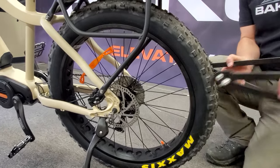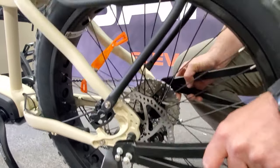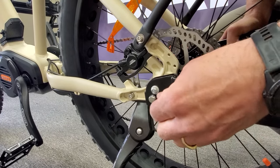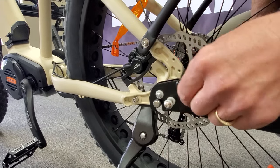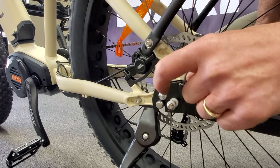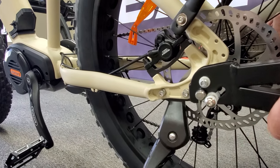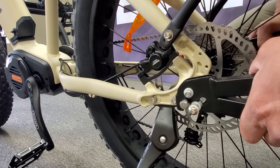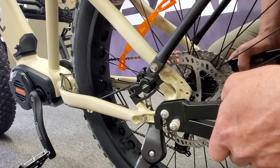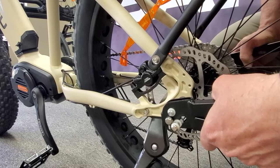Hooking this onto the bike is basically just hooking on each side. You want to make sure the bolt and nut are fastened and secured — we recommend pulling that out and putting some Loctite on it. When you put it on, lock it down and make sure the lock pops back out completely so it locks on. You don't want it halfway down while riding, as it could pop off and twist the frame.